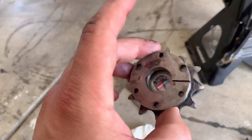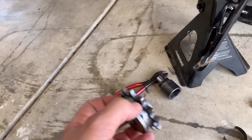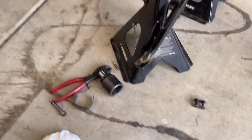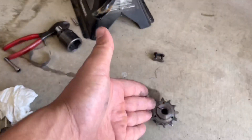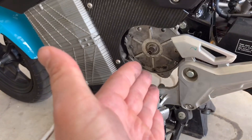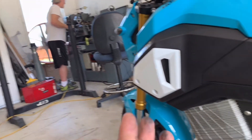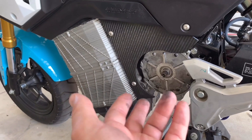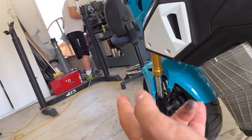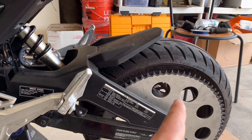Right now we're working on a new sprocket mount. This is our old one — basically we couldn't fit a smaller front sprocket because of the design. Now we're making a new one using an old Alta motor gear that fits perfectly on the spline, so a lot less custom work to be done. We're really just milling it down and making an adapter, which we'll show you when it's done. That's going to allow us to have a smaller rear sprocket as well and maintain the same gear ratio.